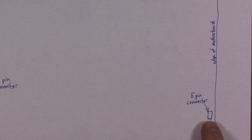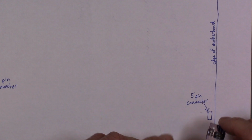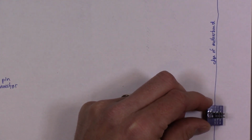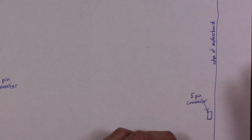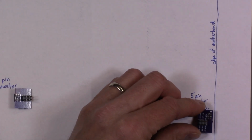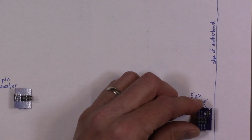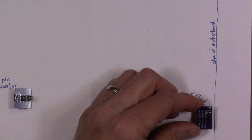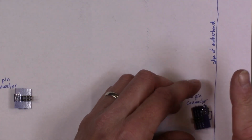There is actually a similar issue on the other side of the motherboard. There's this 5-pin connector that connects the power switch, power LED, and diagnostic LED. And the Harbin Repairs adapter PCB for this connector hangs off the side of the motherboard, and so if the motherboard's very close to the power supply, it won't fit. And again, I designed my own modified version of this that doesn't hang off the side. It's not going to be necessary for our Presario case, but nonetheless, it's nice to have these two adapters that fit within the profile of the motherboard, because basically that allows us to use any micro ATX case at all.